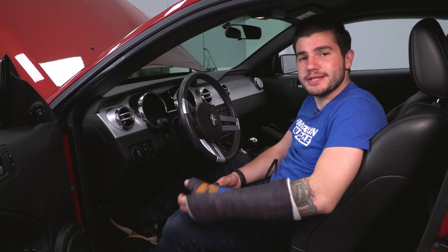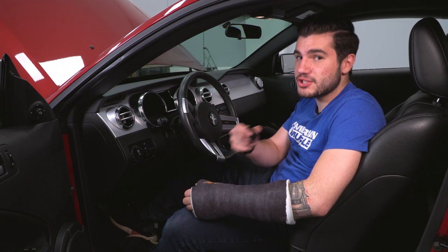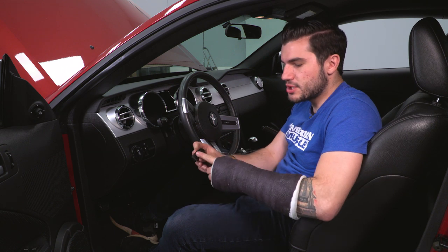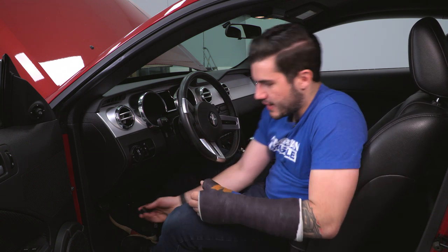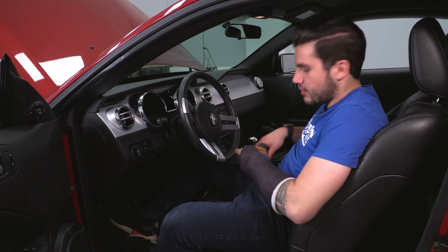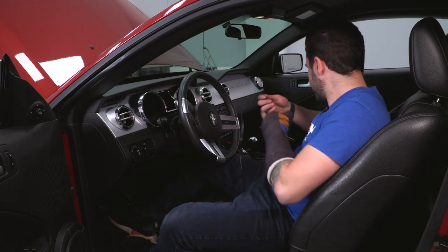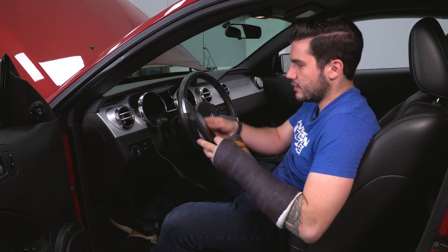Now guys, once your intake is done with the installation, you can grab your OBD2 harness included in your BAMA Rev-X tuner kit, and we're gonna plug this portion into the OBD2 slot underneath the driver's side dashboard, which on your 05 to 09 is gonna be on the left-hand side. So just find that, plug it right in, and the other end's gonna go right into our tuner, just like that. All right, now we can get to tuning.